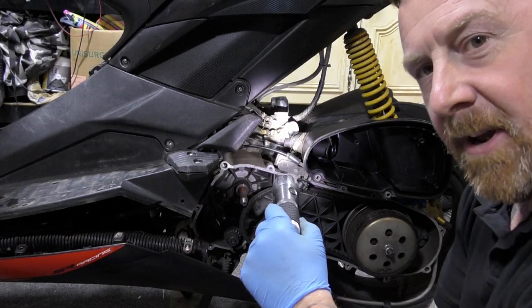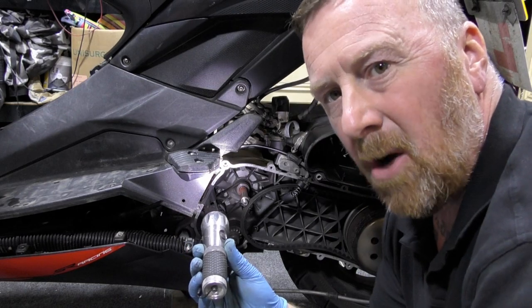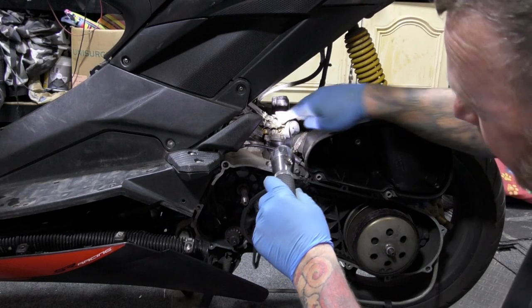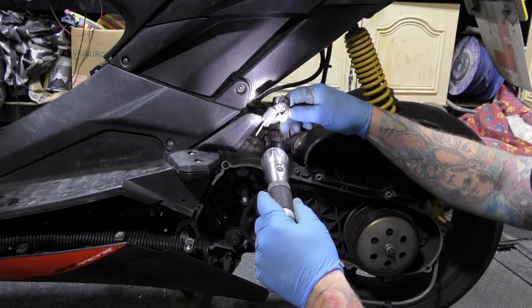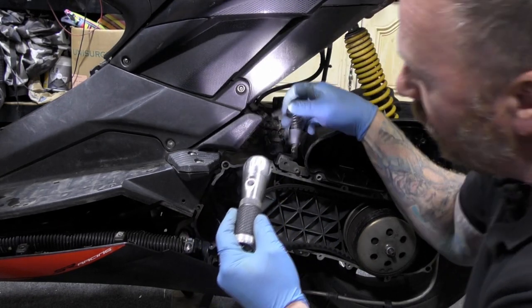Now, I've said this before about the carburetor. Now, I've done videos on the carburetor. Just type in Mark Savage carburetor, and they all come out how to clean them. So I've just cleaned this. I'm popping it back in now. Done the auto choke. But this, I've mentioned many, many times. It's something a lot of people get wrong. It only goes in one way.